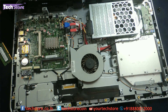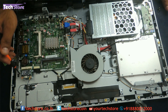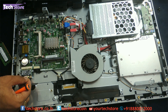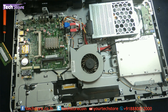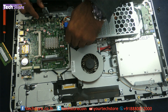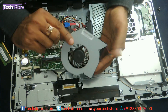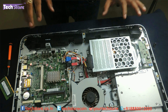This is the motherboard. If your motherboard has failed, you just need to buy a similar one available at HP service centers and remove these five screws — along with the connectors — and you are done. The fan can also be cleaned by removing three screws. Before removing the screws, remove the fan connector very gently, then clean the fan and place it back easily.